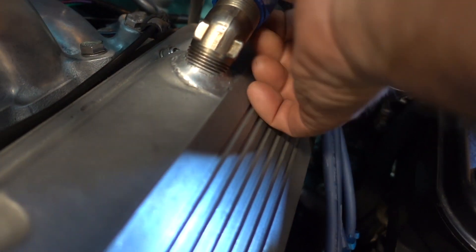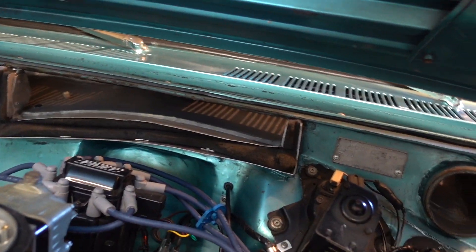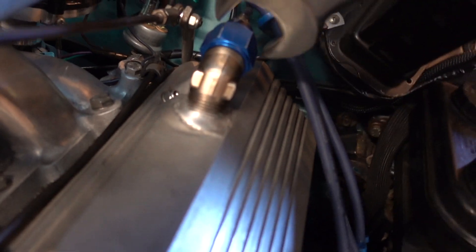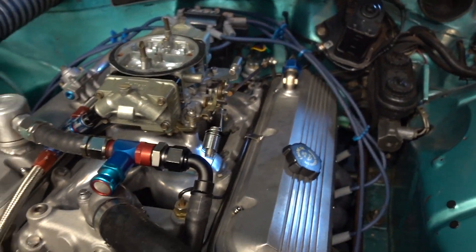All I've got to do is hook up the vacuum line for the suction gauge. This is on such a big fitting because if I decide not to run the vacuum pump, or if the belt breaks while I'm out, then it's easy to put the breather up onto this valve cover. With the breather on there and this side open, the motor breathes normal without the vacuum pump.